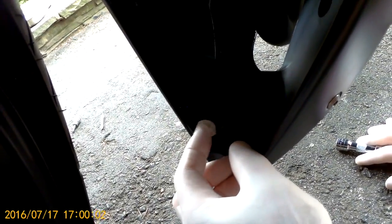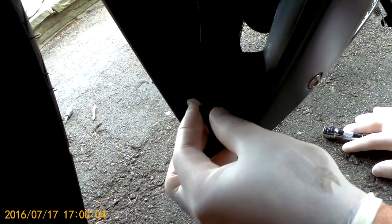Now, in the middle, there's a plastic push clip. You push the center of the clip, that will push in a plastic holder or screw holder, and just pry that out, and it should come out quite easily. And that holds the two fairings from the right to the left side. On the inside, there are clips that will need to be unclipped so the rest of the pieces can separate from each other. There's also a bolt in the center that needs to come out.